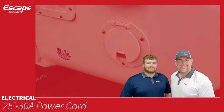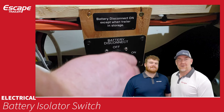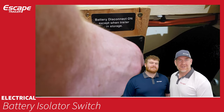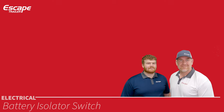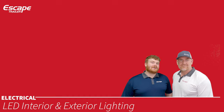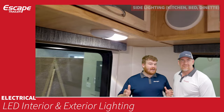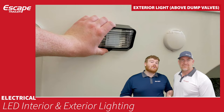A 120-volt adapter also comes with the trailer. Battery isolator switch disconnects all power from the battery — important since propane and smoke detectors continue to draw power, so flip this switch when shutting down for winter or even a few weeks. Deep cycle 12-volt lead acid battery offering about 94–95 amp hours — for boondocking, battery upgrades are recommended. LED interior and exterior lights: interior lights at the dinette, bed, and kitchen; exterior lights on the passenger side by the entry door and on the driver's side above the dump valves.